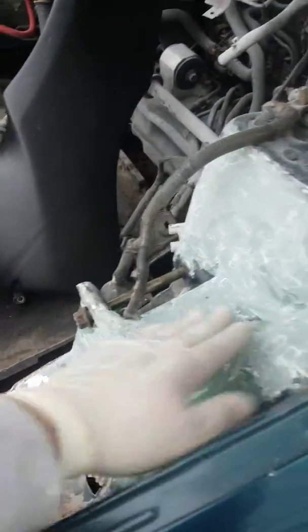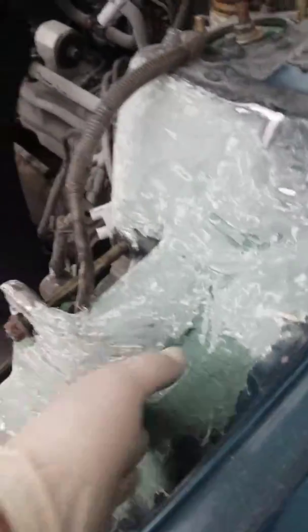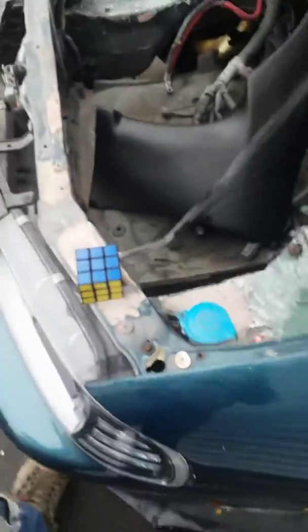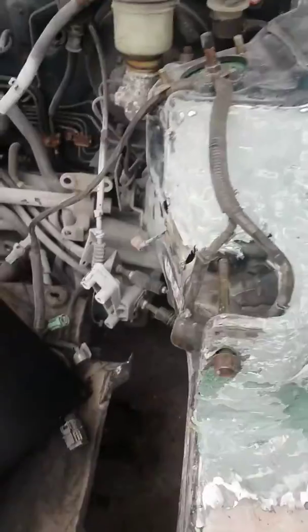Same with this side. I started with one piece right here and then connected another piece right here. I don't know how many of you guys have stock bays, but you know how much filling you have to do, laying pieces of metal to fill this in. I've just been using sheet stock, about a 16th of an inch thick, not even. Just sheet steel like they would use on fenders. I've been cutting that up and welding it in, doing tack welds all the way around, grinding it flush, and then fiberglassing over it. It makes a hell of a difference, if you can tell how thin that is right here.